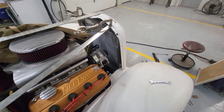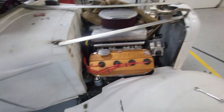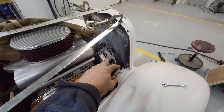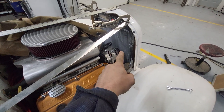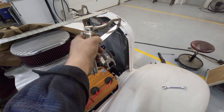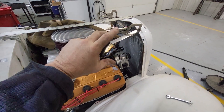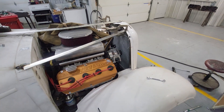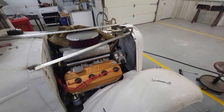I'm getting them the same by keeping that bracing in, then adjusting the shell side to side — very limited, but if you need to adjust fore-and-aft or side-to-side once the car is sitting on the ground, I can adjust at the bottom. I can adjust this distance up here. I can do one side differently from the other. Within a quarter of an inch max per side — maybe 3/16ths — but you can dial it in.